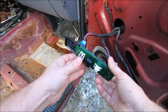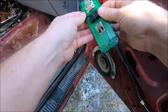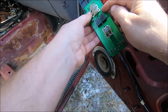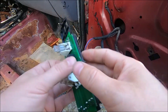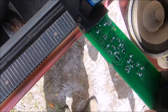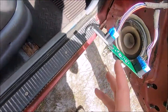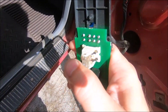We'll plug everything in. I can't feel if the relays are working or not — it's these upper two that are working. With these micro relays, you don't know if you feel a click or not. I can test them with a meter. I pulled this door lock module off, took it all apart in preparation for troubleshooting and possibly replacing one of these micro relays soldered to the board, or figuring out if a diode, resistor, or capacitor is bad. Then I started hitting buttons and, lo and behold, it works all of a sudden.